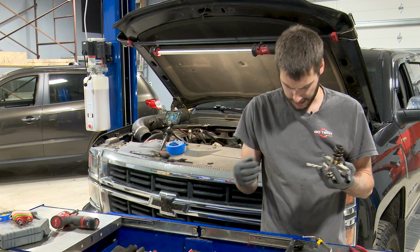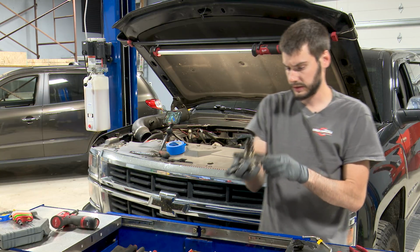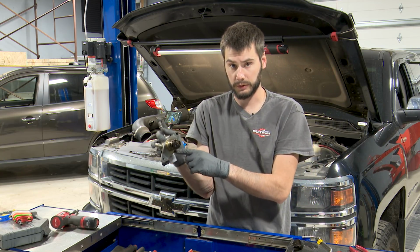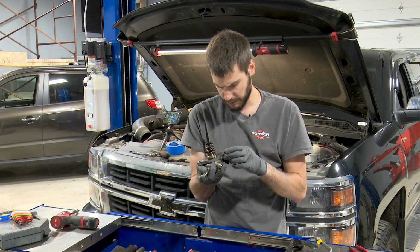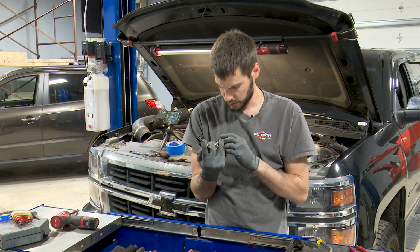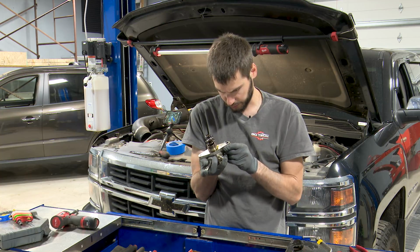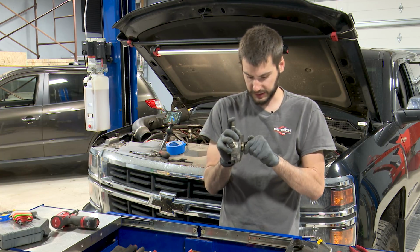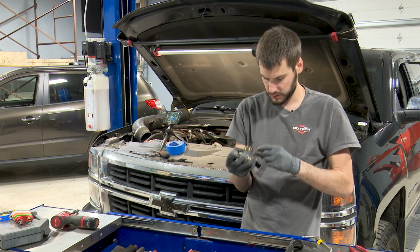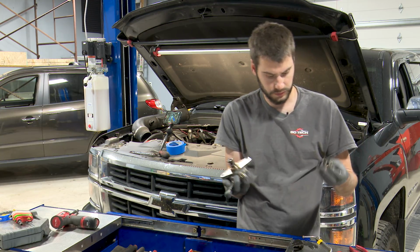So yeah, I guess somehow we have a leak in this surface here. I would assume how it goes into the crankcase. That's what we're thinking. And maybe bring this up to the microscope and take a look and see if I can see anything. But I mean, there's definitely a redesigned part number for this guy, so there's definitely a known issue with this thing.